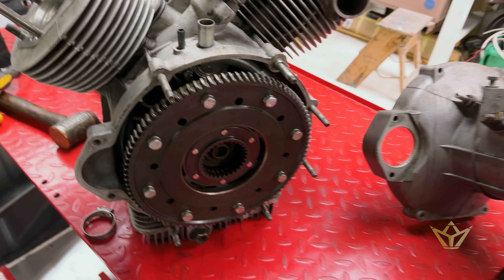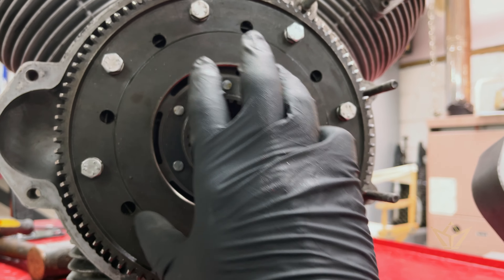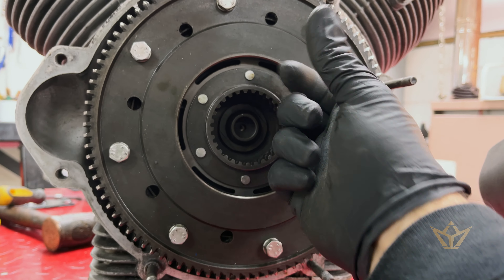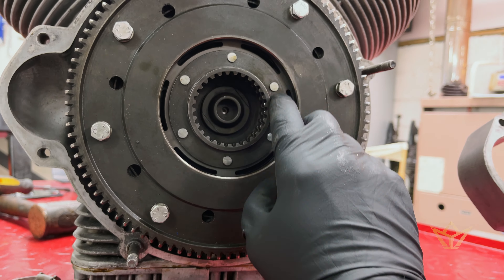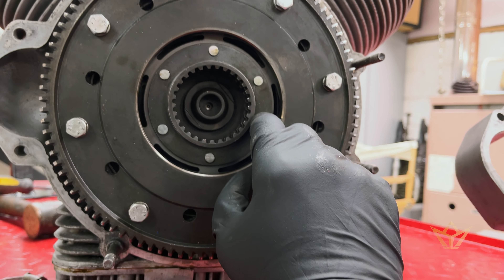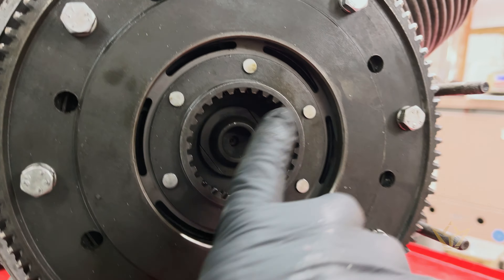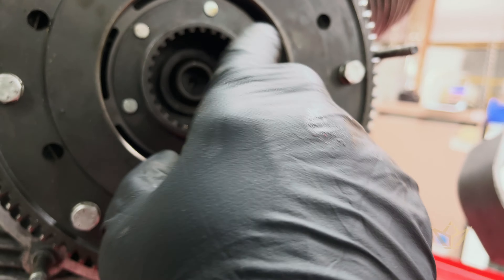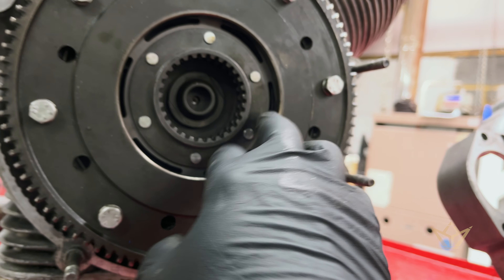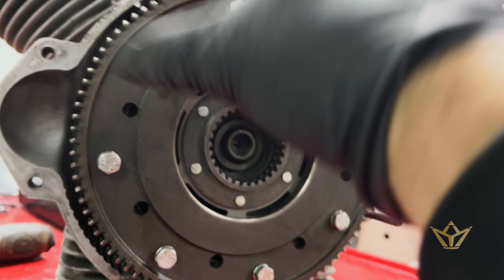A little point on this clutch and flywheel fitting the gearbox onto the clutch — you'll note that when you fit the components in place, the clutch moves freely inside these two sandwiched bits, two plates with springs in them. So when you start to bolt down the outer clutch plate, you tension up, or compress, these plates in position and they could be slightly off-center. They need to be centered because you have a gear which has to slide in to not one plate tooth but the second one, and that drives the two plates within the clutch. I suddenly realized to my horror when trying to fit this that unless this thing is exactly center, you can't get the gearbox on.